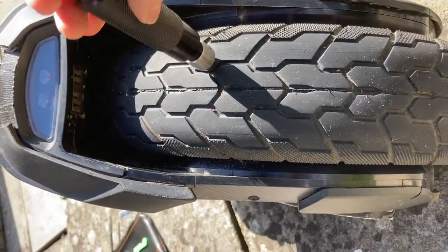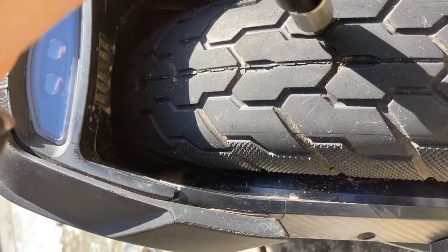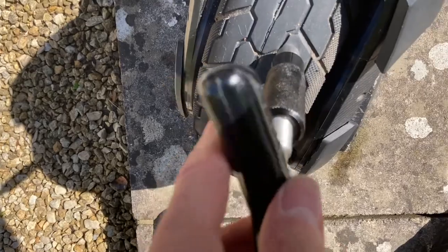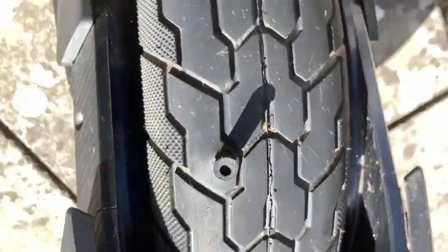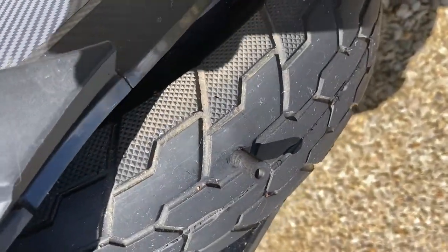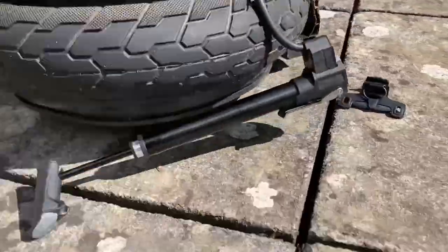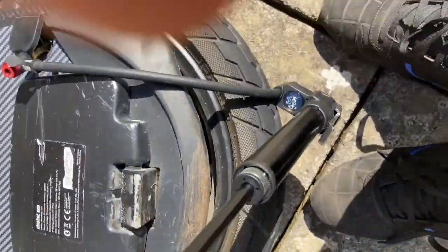Yeah, there we go. So we now screw the plugging tool into the funnel, where we've just taken the prodder out. Everything just interchanges, you just swap tools, and it's quite handy. Then you screw down tightly. I got this bit wrong the first time. I didn't push it hard enough, and when I pulled the thing out, the plug was still in the tool. So I did it again and pushed it all the way down, made sure the screwed tool just couldn't go any further.